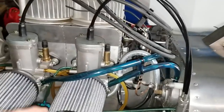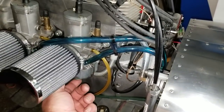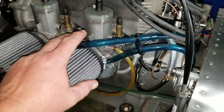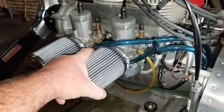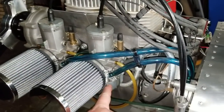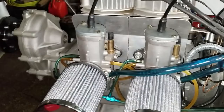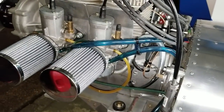Jimmy has suggested a possible fix: we need to take the main jet out — the fuel jet on the bottom — and replace it with the next size up so we can get more fuel on the top end. I'm going to call Matt at RPE again on Monday, let him know what we've been doing and what readings we're getting. I think what I'll end up doing is replacing the main jet in this carb, going from the 170 up to the next size bigger — whether that's a 175 or 180 — grab a couple and see if that helps us run cooler.